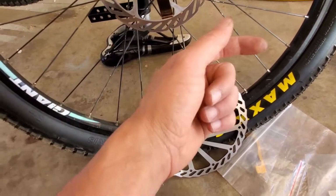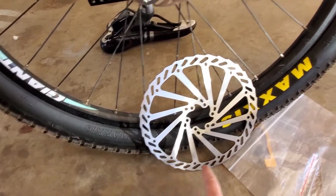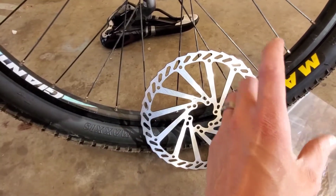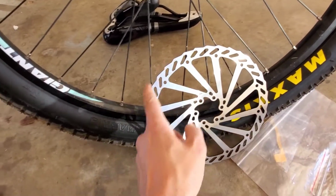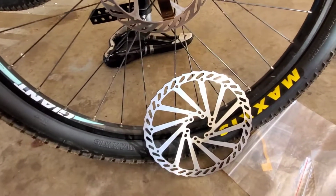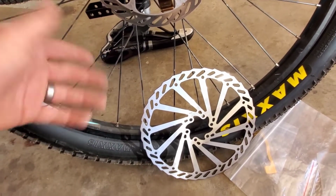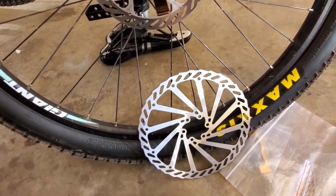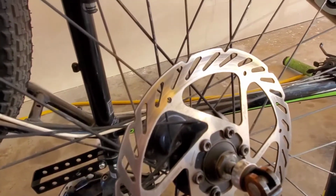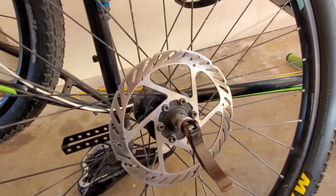If it takes you 20 feet to stop, the rotation is the same, but the distance around the brake is greater, and so the rotor is actually going to be dissipating more heat by the time the caliper comes back around. So that's a big part of having bigger brakes. And they also stop quicker, so you have both of those things working together, and so your brakes don't get all nice and heat treated like these ones are. And I'm not even riding hard. This is very gentle riding, just cruising around and then stopping.